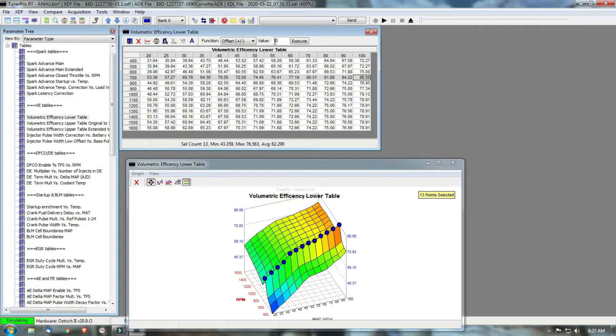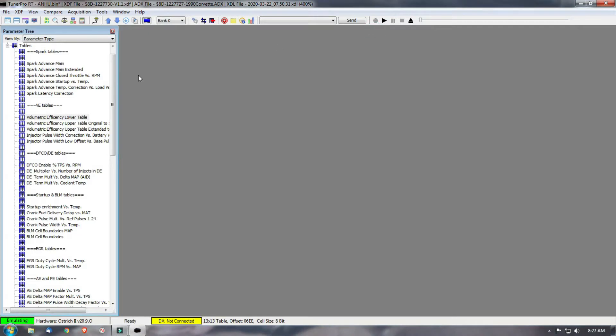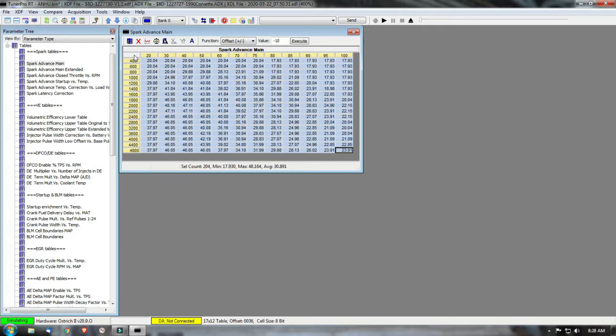Now I'm going to change it back and execute the same thing — upload it to the emulator, there it goes. If you have your wideband hooked up and you're in that RPM range, you'll see it richen up and you'll see it lean out if you lean it out. Same with other settings like timing and other things. I believe there are some things on here you can't do with the engine running — I'm not really sure; it may vary according to your application, so that's something to consider.